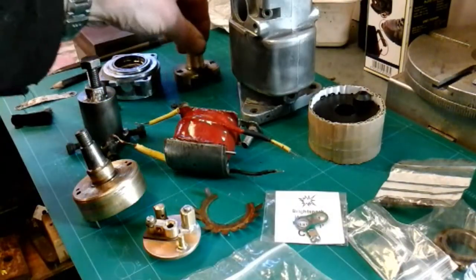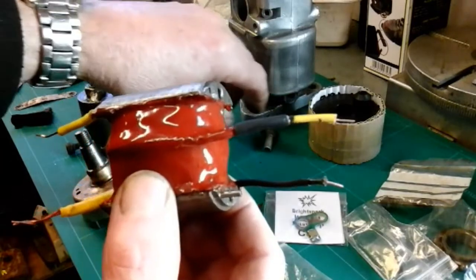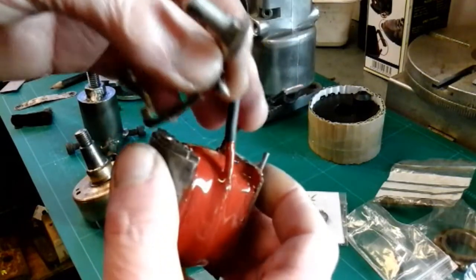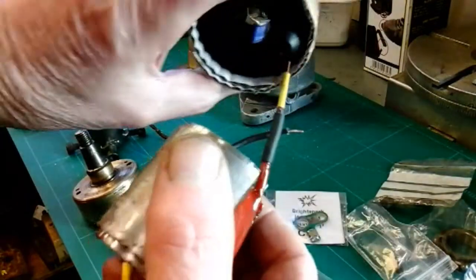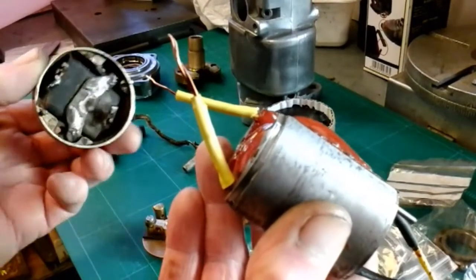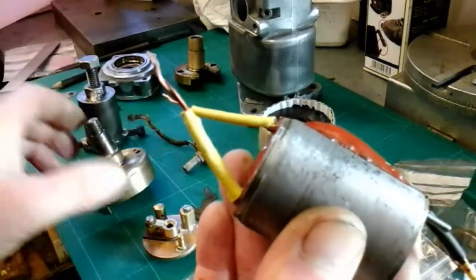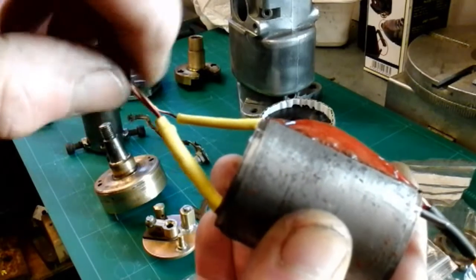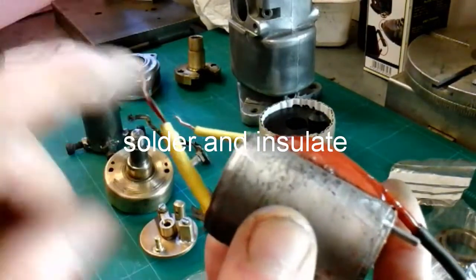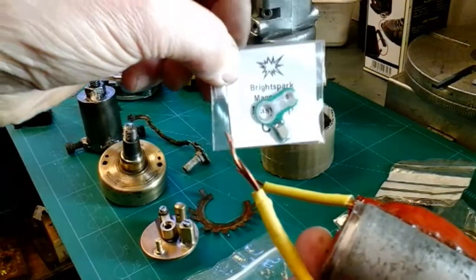Where I'm up to now, I've just got to cut these wires on my armature which I've rewound, to get my point centre on. That's got to go on there. And then this has got to be cut down to an appropriate size to fit into the slip ring. On the other side, this side will just go to earth — original earth — where the old condenser went to. And then this one won't attach to the old condenser. I've just got to solder these two wires together and tie them so they fit into that back case, because we're no longer using that.